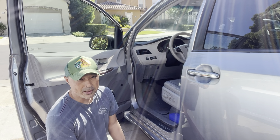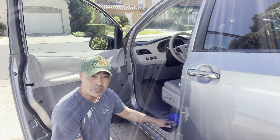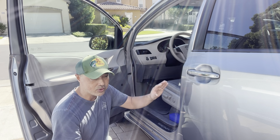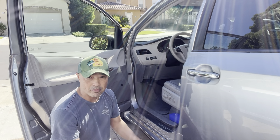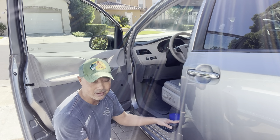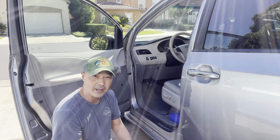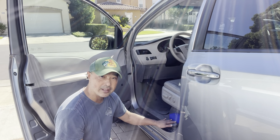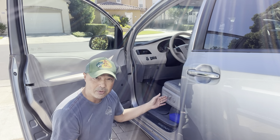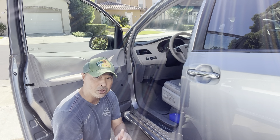Working on the final touches of the couples camper. I need to make a switch box right here. In the past I've been manually plugging and unplugging my solar panels — using them as a battery tender for my car battery, then swapping back to power the microwave and everything else. Since I don't drive this van often the battery gets weak in about two weeks. I want a switch that toggles between charging modes, including charging from the alternator while driving, since the alternator charges a little bit faster.